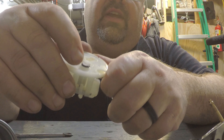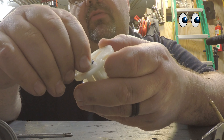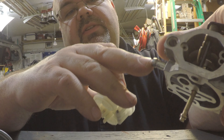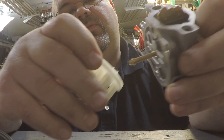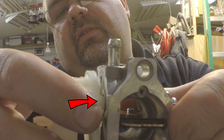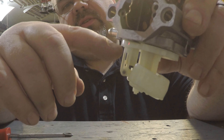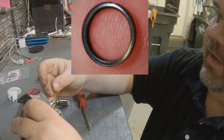Sometimes this gasket will come off inside the carburetor. This gasket is one of your main reasons this carburetor will flood. When it's inside, it seals this hole — the inlet for your fuel — so fuel comes in here and runs down into that hole. If that doesn't seal properly, gas is going to run over the top and flood the carburetor. So even if your needle and seat is good, it can still flood just because this little o-ring is bad. This one does look a little flattened out, so we'll replace it.